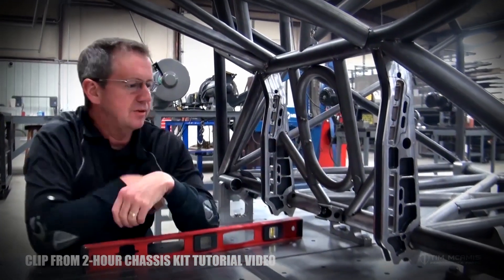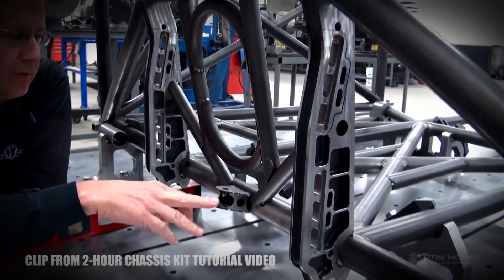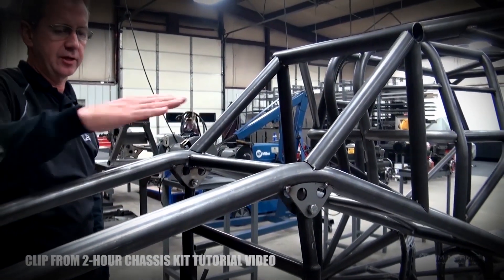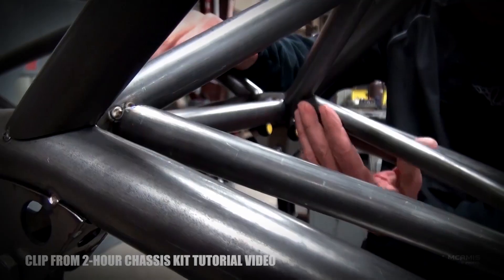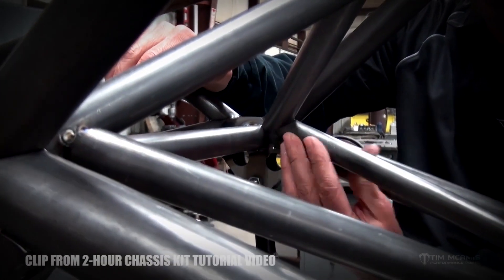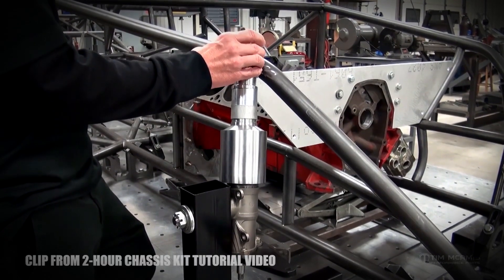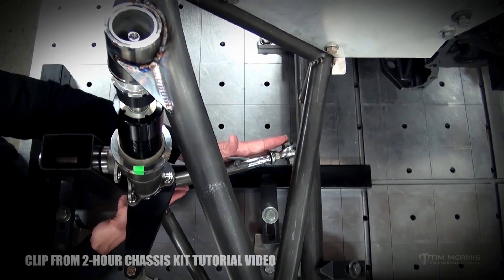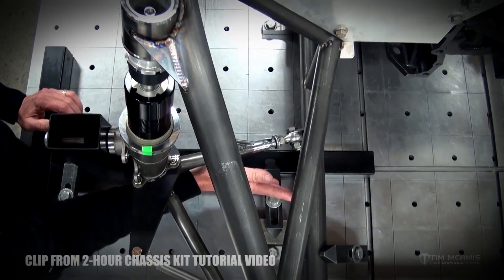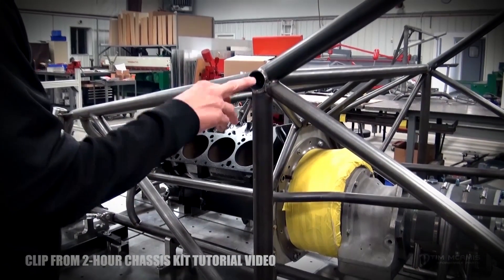While we're in this view, we can see the wishbone tabs tacked on here at a little bit of an angle. Once located, they're cut to a radius so they lay in the bent area of the rear frame rail. Use the tab or the cup and mount it on top of the strut so that when you're applying the brakes, the control arm has a good angle to push into the chassis. You don't want it straight — you want it back behind that axle centerline. Those will get capped and welded 360 degrees around, finished off and supported properly.